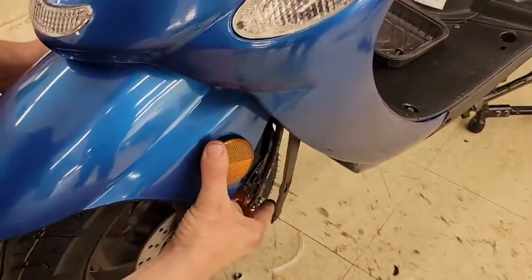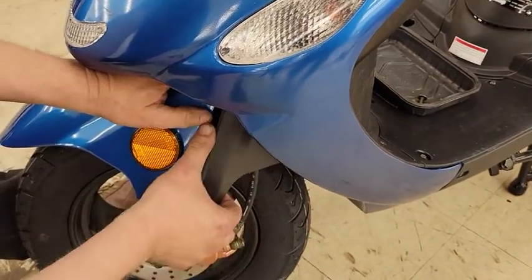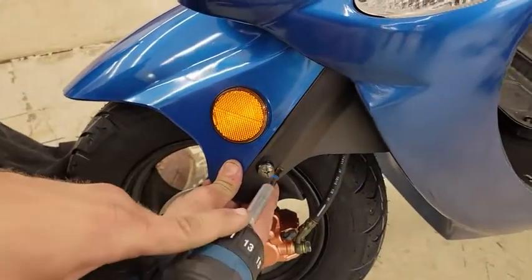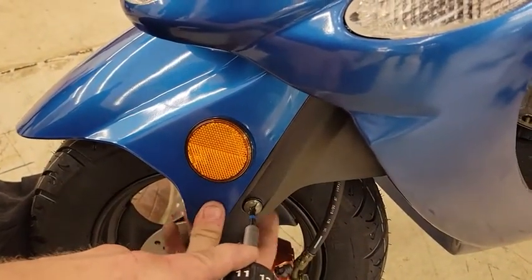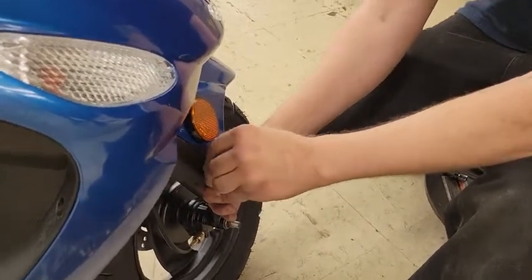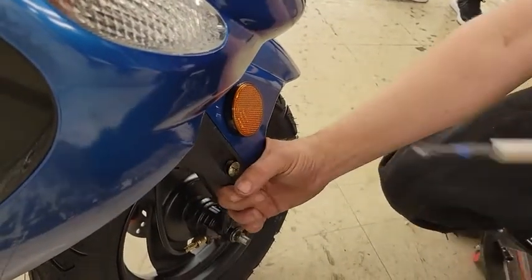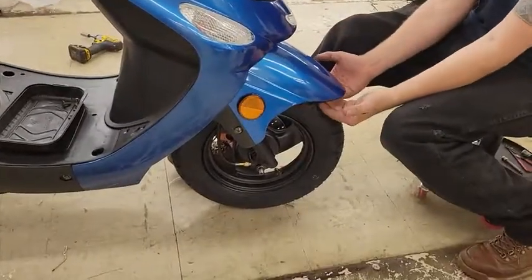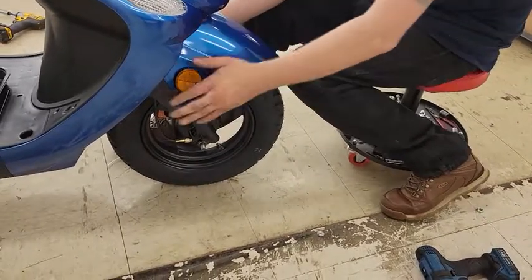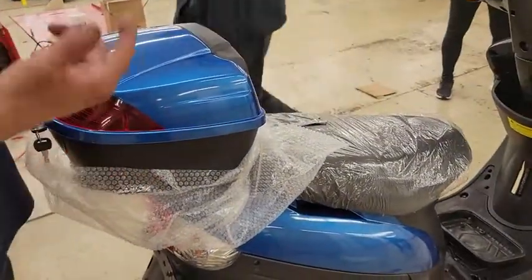Pull those out just a little bit and spread them out — I'm going to go in here, hook this up to the top, and drop this down on here and this one as well. Now I've got a slot here at the bottom and it's going to help get me into alignment easily. I can use my tool to zip it down, holding them in place with my finger so they don't shift. I have to just work with the edge and my alignment is already there. I'll start that by hand so I know it's nice and I'm not crossing the threads. I'm also checking that my tire and fender spacing are correct — if they're too close, when you get somebody big on here they might actually rub, so I'll bend that back and pull it forward a little bit.